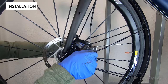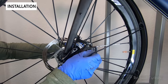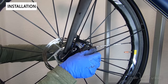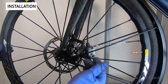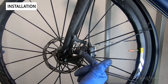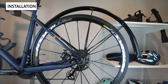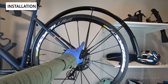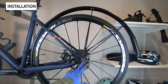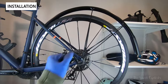With both sides loose, I can move the strut in and out to adjust the gap and get it even. This gives a nice even gap all the way through — a great feature that makes adjustment easy without cutting. However, the adjustment range is limited to about two inches, so if you're really far off you will have to cut. For the rear fender, I'm definitely going to have to cut the struts because the chainstay flares upward, placing the eyelets quite high.